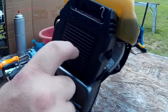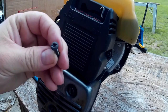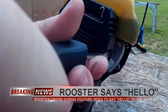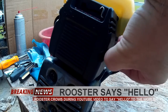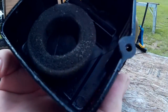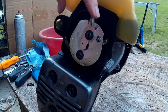The first step is going to be to remove this plastic cover - that'll be two screws on this particular model. They are star bits, but you can also use a plain blade. This particular Craftsman has a three-position choke lever: choke, partial choke, and run. You'll move the lever over to the choke position so you can pull the cover straight off, which exposes the air filter and the choke plate mounted to the back of the carburetor.